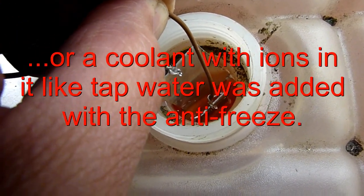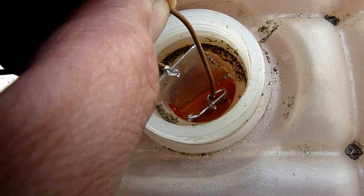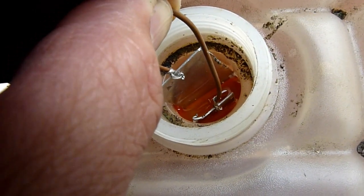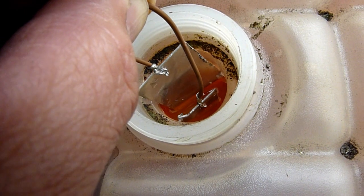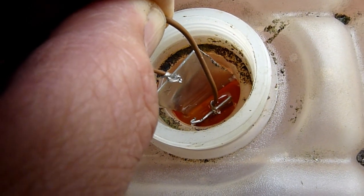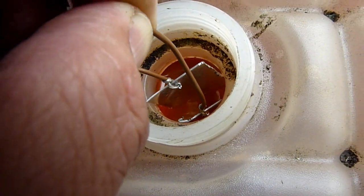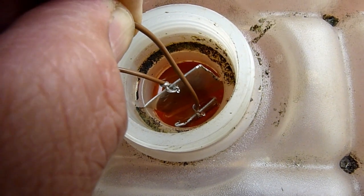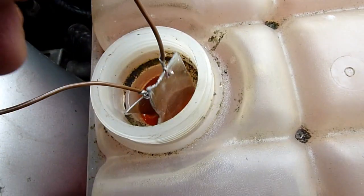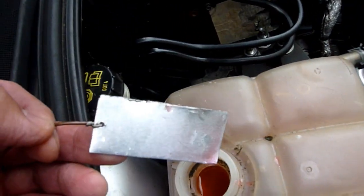So if it was leaching metals from, I don't know, the aluminium part of the engine block, or the cast iron, there would be ions in there now, which means it would conduct. Would be conducting electricity. It means it would be bubbling everywhere. Pinhole bubbles, bubbles escaping. Remember the tap water? How electrically conductive that was? How easy you can... Nothing on there. Nothing on there.